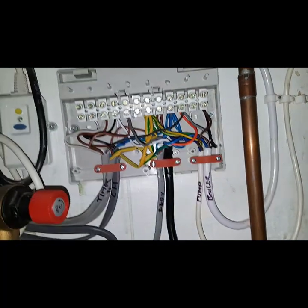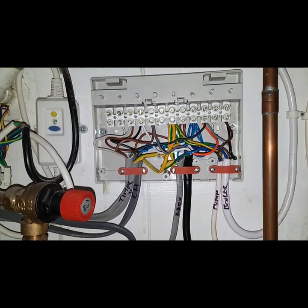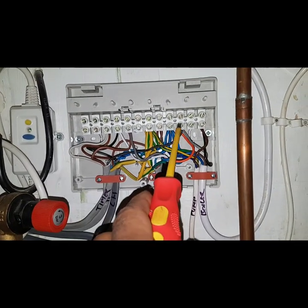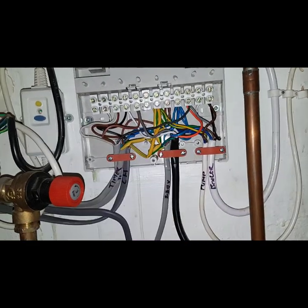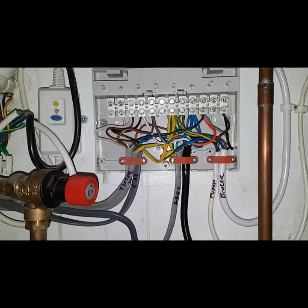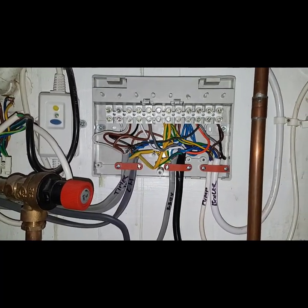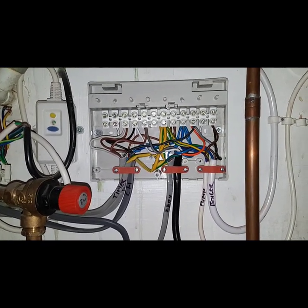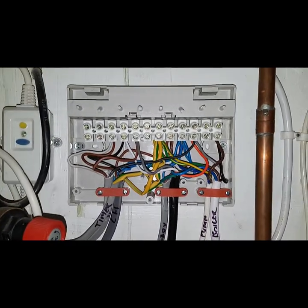That's my standard training. So if the customer's saying they're not getting hot water, what we need to know is: are we going to get power at that connection? So we'll go across there to neutral to see what's going on — that's what we can start from. Understanding that sequence we went through has helped us narrow it down quite quickly where to look in this basic jungle of wires.